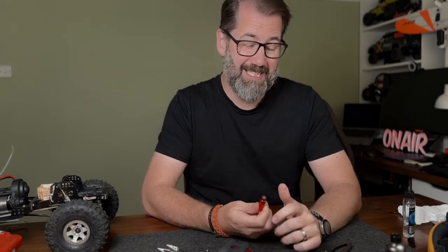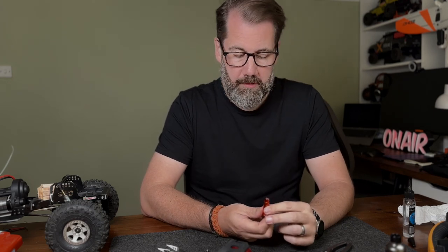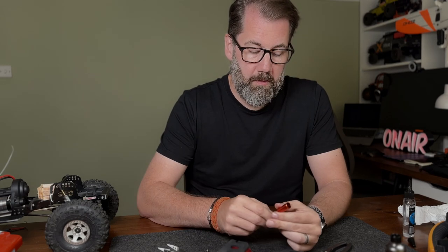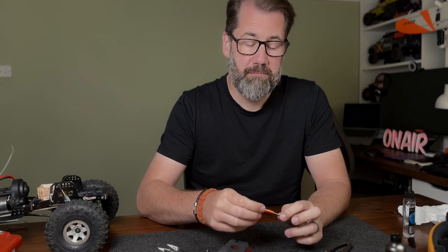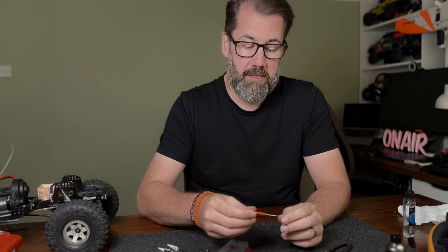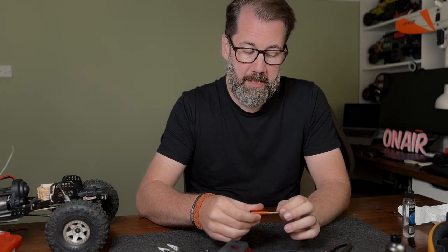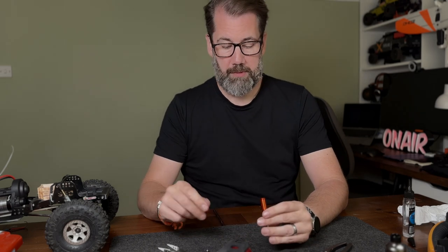It's not difficult really, and you don't really need specialist circlip pliers. You can get away with those side cutters. And that can just drop now into place. Okay, and that feels nice and smooth. If you're worried that that's got a lot of resistance on it, don't worry at this point, particularly if you haven't used green slime. As soon as you've got some oil in there and that lubricates that shock shaft a little bit, that will be nice and smooth, or should be anyway.